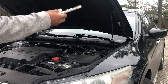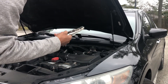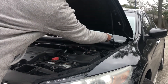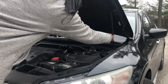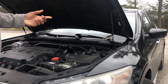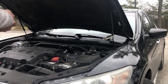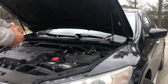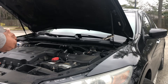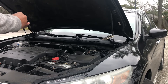Sometimes I got it rested on my head, but with this, what you want to do is just clip this onto your strut and adjust it to the proper opening so that it doesn't crush your strut — it just squeezes it. Put it right there like that, and there you go. That'll hold your hood up as long as you need to work under it. It won't come down. That can either be a temporary solution or a permanent one — you can wait till you get your hood struts and do this in the meantime, or just do this from here on. That's how you get by with weak hood struts.